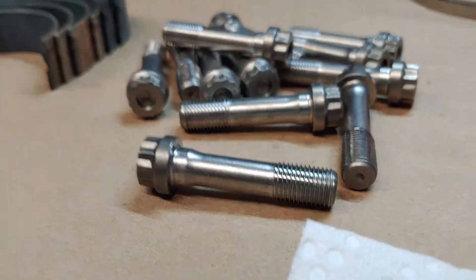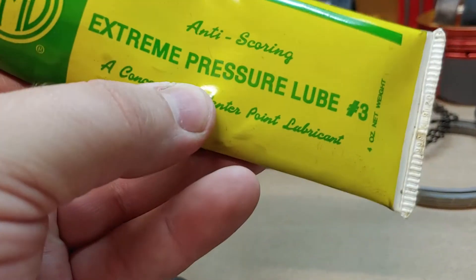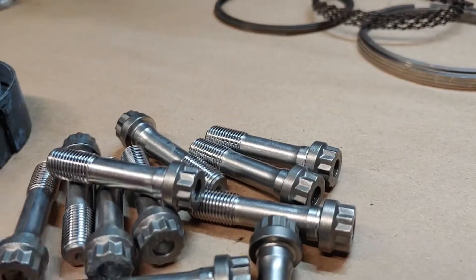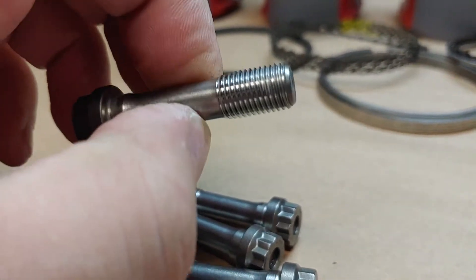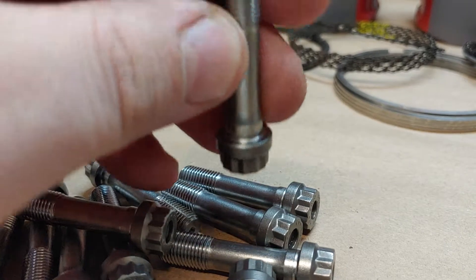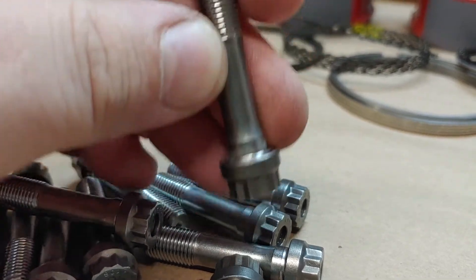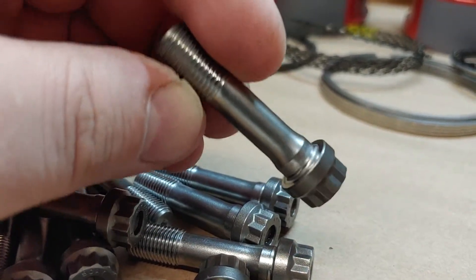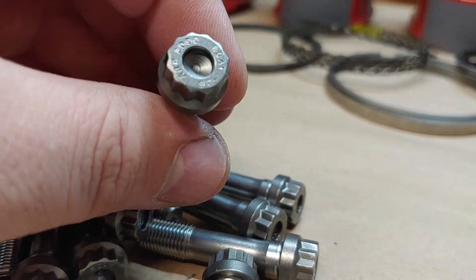We like to run what's called CMD3. This is a high-pressure extreme lubricant. We have found this to be a little bit better in our opinion here at the shop, and there are other shops that use this exclusively on all their fasteners. It clings to the part really well — it doesn't behave like anti-seize the way ARP lube can. Please take what we're saying as a personal preference, not an end-all be-all, as thinking that ARP ultra lube is no good. It's just what we prefer.